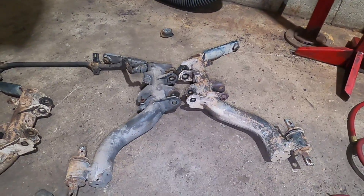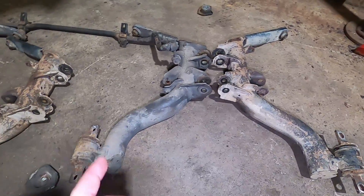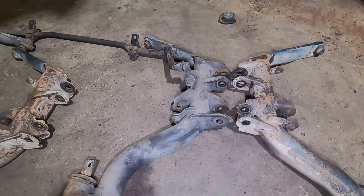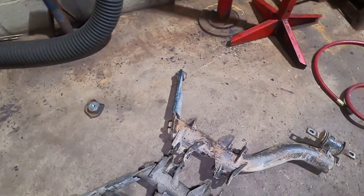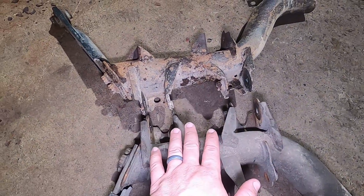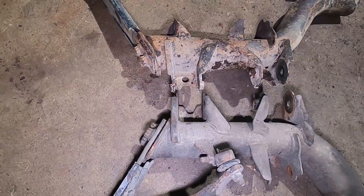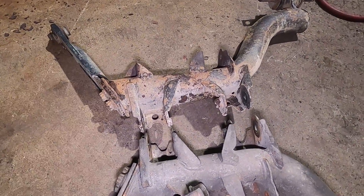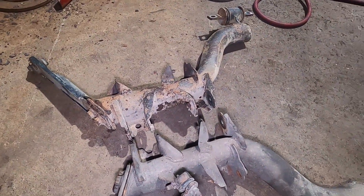The big question is which trailing arm to use — the RSX trailing arm or the CRV trailing arm. I thought I might try the RSX arm to easily retain a sway bar, since this is going to be a track car. However, it's not going to work because there's a difference in how the mounting tabs line up to bolt up the spindle — the rear ones are slightly offset. We could try prying them, but that seems kind of ghetto, so the best course of action is to use the CRV trailing arms. We'll clean these up, do new bushings, and install them with new spindles.